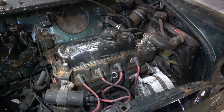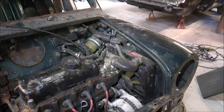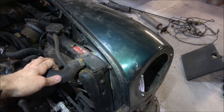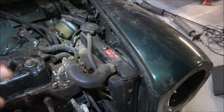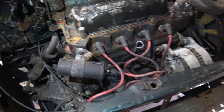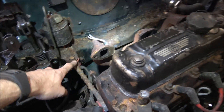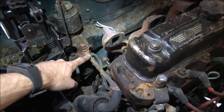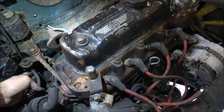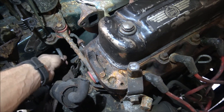As I mentioned in the last video, I've started to strip out the engine bay, so I got rid of a lot of the stuff that's going to be in the way. I made a decision not to take out the radiator because it's attached to the engine block and the engine mount, so it's just going to be easier to unbolt those parts and lift it out. The gearbox is part of the whole unit, so it'll be coming out with it. We've got the engine steady here which needs to be unbolted, and we also have the engine earth strap. We have the clutch slave cylinder connection — we're probably going to cut that hose with a pair of cutters to make it easier.